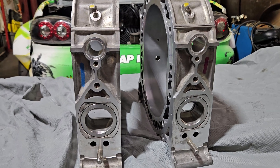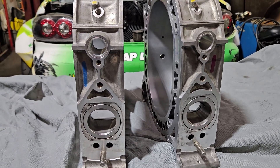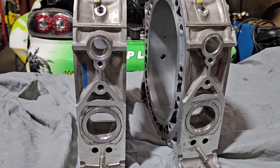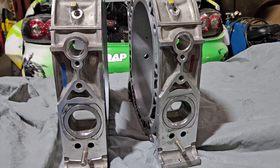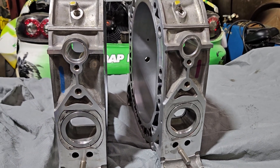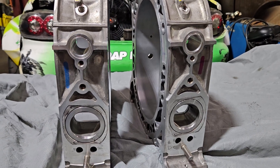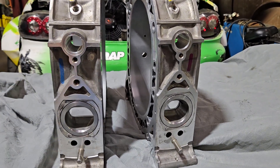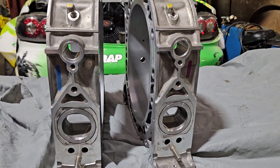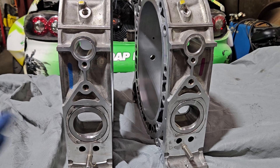These motors work from about 5,000 to 10,000 RPM, and sometimes 10,000 RPM-plus, depending on what people are doing. That can start to become an expensive proposition. By the time you've got lightweight rotors, you're probably trying to go high compression. You've got ethanol, alcohol, methanol — some kind of high octane fuel. A lot of aggressive porting being done — that's a lot of service work. This is going to need to be a studded block; you've got to maintain that block tightness. You can't let these things flex and move around.